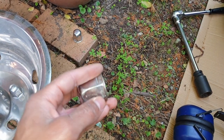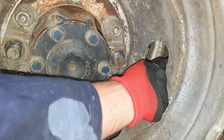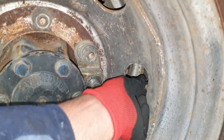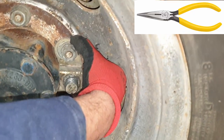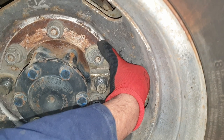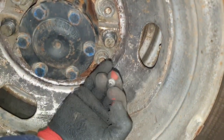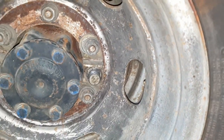We'll go ahead and fill the inner and outer tire. Sometimes you might find it really difficult to remove the plastic caps on the tire valves, so you'll need a set of needle nose pliers. You have to stick your hand in through the rim or use the pliers to get to the inner cap for the inner tire valve. If you've never done this before, you might need a set of pliers — it'll be too difficult otherwise.